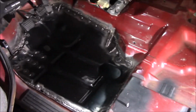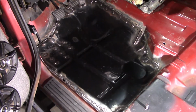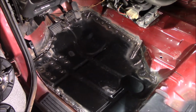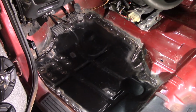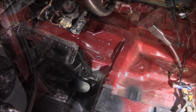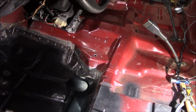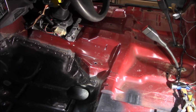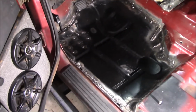The next step after this is to seam seal everything that's got a weld on it. So seam sealed from top and bottom both. And then throw some paint on everything. Let that cure up a day or two. And then lay down some sound deadening and redo the insulation and the carpeting. But all of that is probably the next video. This is probably enough to conclude this video.